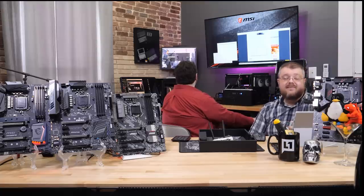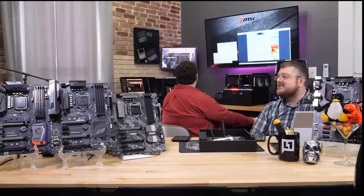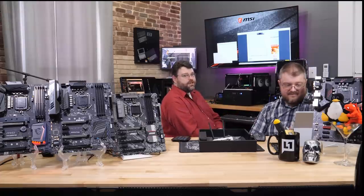Is Coffee Lake best caffeinated or decaf? Is that the K models versus the non-K models? I'd always go with the overclock. Yeah, well, the i5 non-K, if you could save a few bucks on the motherboard by not getting the Z-Series chipset, which is impossible right now, the non-overclockable i5 is a really, really good deal in terms of how much compute you get and how fast it is. It's way over 4 gigahertz for its built-in boost. And the K i5 and i7, even though the one core speed is 4.7 gigahertz, basically all the cores will work at 4.7 gigahertz as long as your cooling is okay.